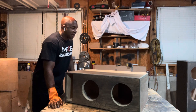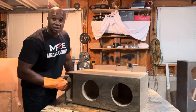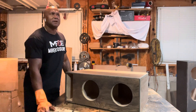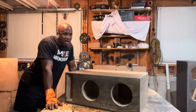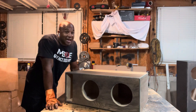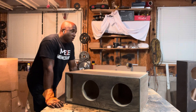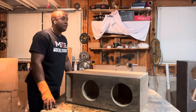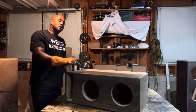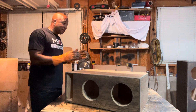I said, man, that's going to be the same size port that you would use in a ported box, so you wouldn't really gain any output. And when I explained it to him — follow me so y'all understand this — fourth orders are way more efficient within their passband than a regular ported enclosure. A fourth order does have its limitations though: they're customarily larger than their ported counterpart.